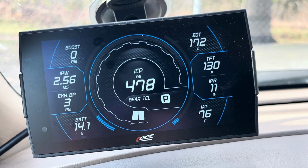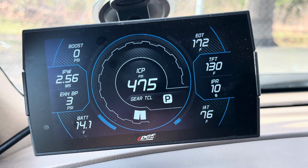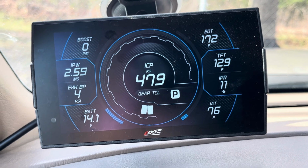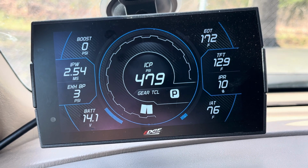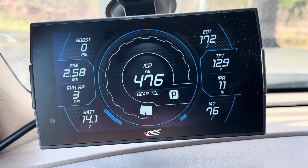So I want to reiterate, there are two that I talked about at the beginning. Your fuel pressure on these trucks is really important. Definitely get a gauge. Even if it's just a cheap gauge that you mount on the test port on your fuel filter housing. It's better than nothing. Obviously, it's better to have one in the cab if you can, or have one connected to your CTS3 or whatever monitor you might use, but it's still good to have.